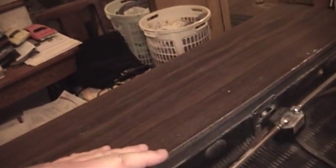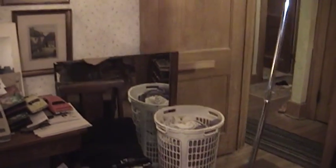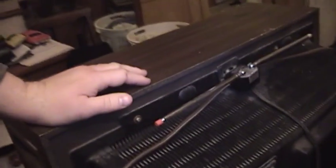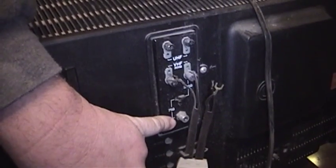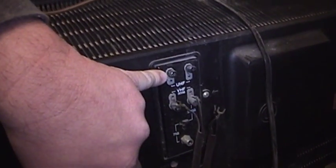We'll go ahead and take a look at the back of the set here. It's in pretty good shape — it could use a cleaning. Got a little bit of damage to the woodwork here, but nothing that probably couldn't be fixed by someone skilled with veneer. Here are the original Sony antennas that came with the set, still in very good condition, not bent at all — well, maybe a little, but certainly not enough to matter. Where televisions today typically hook up to the antenna with just one connector, this television comes from a different era when the UHF and VHF antennas were separated. Sometimes the VHF would come in over 75-ohm coax, but the UHF came in over 300-ohm twin lead. To address this problem when using more modern antenna systems with this TV — where everything comes in over 75-ohm coax — you need a signal splitter such as the one on the back of this set.